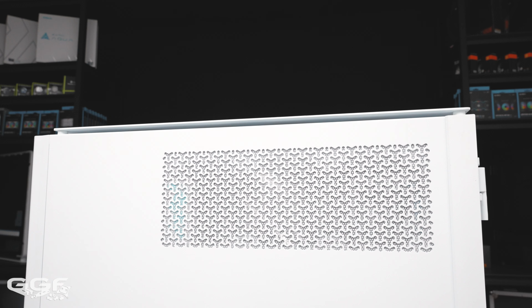So the way around that, you can turn a lot of their devices into a hardware mode where you can offload data to the devices themselves, and you can essentially just unplug the USB. So what I did is, by default, when you have these set up without the USB, they're just set to liquid temp. So instead of having liquid temp just on both of them, that'll bypass the flickering. It's only when you want to run the USB and configure the screens, that's when they start to flicker. So I had set one to liquid temp, and then the other I just set to a static Corsair logo. And by offloading one of them to hardware mode, that image was set, and then the other one was liquid temp. So unfortunately, you can't do too much customization if you are running two together. So I just wanted to point that out.